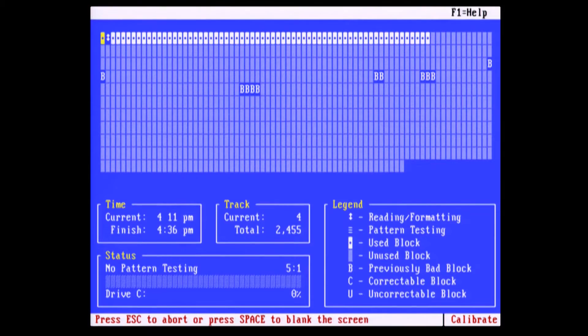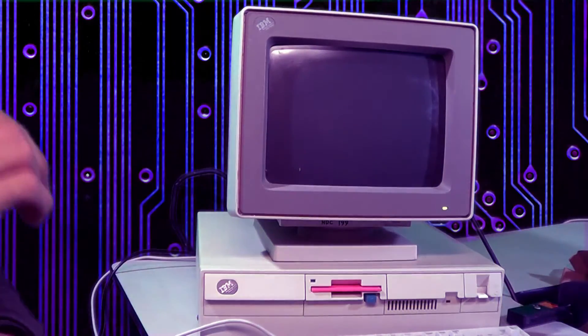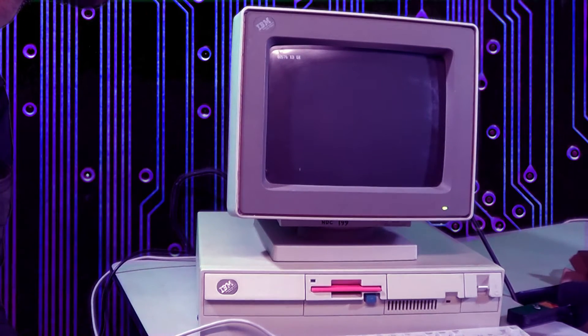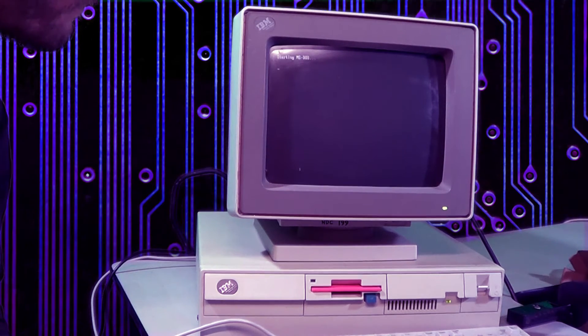Norton Utilities will then make this change without deleting any of my data. It was a bit optimistic on the time — this actually took 4 hours. Now we're all back together, and I took the time to install a few games, some software, and my little networking solution. I should also mention that the reason I used an 8-bit controller was to make sure it absolutely wouldn't conflict with the internal IBM controller. 8-bit cards tend to use completely different resources and have their own BIOS, which makes them a fairly safe option. And I can honestly say that whatever technology IBM used for their hard drive controller, it is no slower than the original drive — in fact, it actually feels faster than the Western Digital that was in there before.